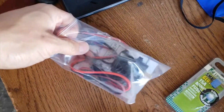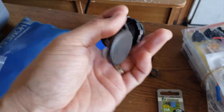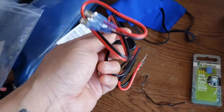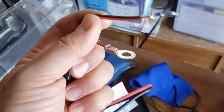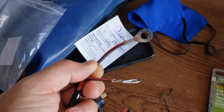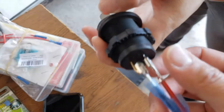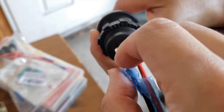This is the USB port that she selected. Looking at the wiring, it's got a simple red and black. The ends of these already have terminals, so we're gonna keep the black terminal the same but chop off the red one and connect it to an add-a-circuit. These two terminals connect to the back ports — there is a positive and a negative. Red's gonna go here and the black one's gonna go here.